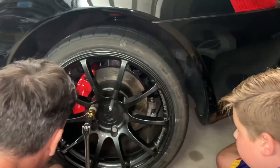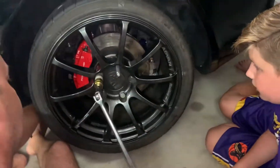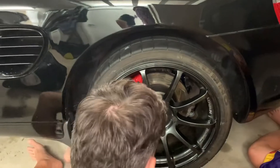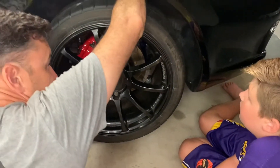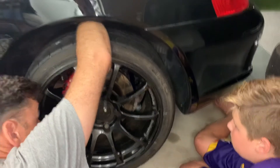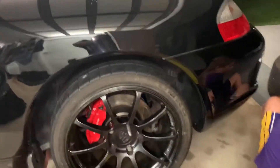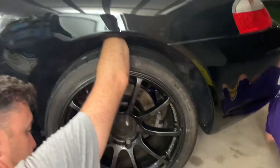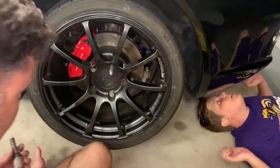It's definitely rubbing on the parking brake cable, but that's easy — we can zip tie that back out of the way. With those two snug, we're contacting the parking brake cable but that's just the Kumho 285s. The wheel itself is going to clear — we're clear. How fat is that! If we run a slightly narrower tire it's going to clear no matter what. Yeah, 275 on here — we're good.